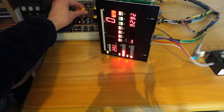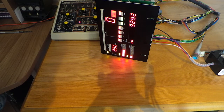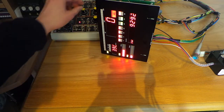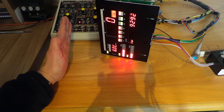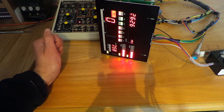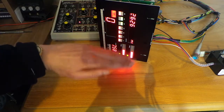Engine temperature is this upper gauge, and we have over-temperature warnings. That may need to be calibrated to your particular car, as all sensors vary a little bit. Fuel gauge is a resistance indicated on this lower gauge. We've put a delay on the response because fuel quantity isn't going up and down very rapidly — without that delay, the gauge would tend to sweep up and down as you go around turns. When you fill your tank, it's going to take a little while to respond.